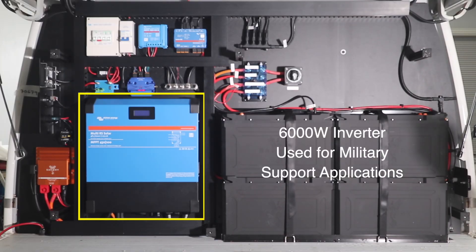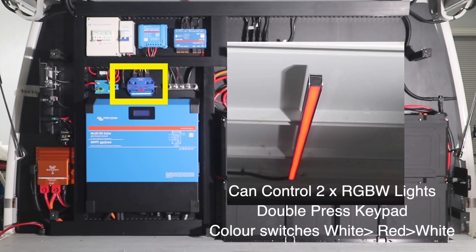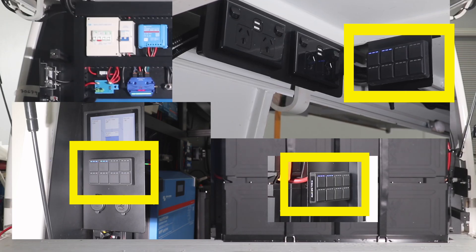We've got a 6000-watt inverter here. We've got the Starlight above the inverter in the center, and that Starlight is controlling all the lights around the truck — just one Starlight, 12 outputs. It's doing two RGBWs because this is going into a defense application and they want red light at night, not the usual amber, and this works exceptionally well. There are three keypads in the truck, which I'm going to highlight, and they are all on CAN going into the Starlight.